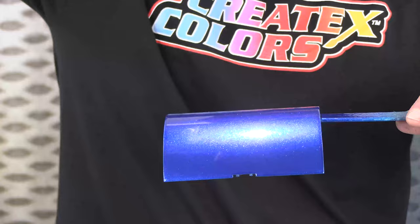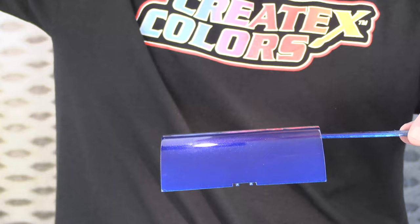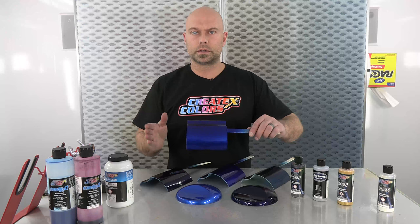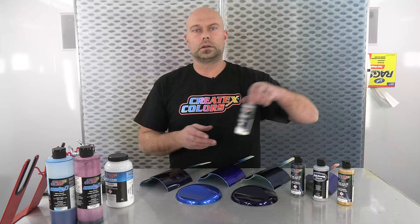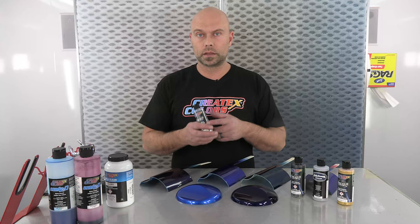Out of direct light, it kind of has a pretty cool purple side cast. Right now in direct light, like most of our flares, one color is a little more prominent — you're seeing more of that blue flake — but it does have a really cool purple side cast. And again, that was color keying — essentially color keying that flare color with an underlying candy or even just a base coat or solid color. It would pair very well as a mid coat before you apply a clear coat. In this case, the blue-violet paired with the blue — it works really well. Kind of like how we talk about color keying our sealer to the base coat we're going to apply.